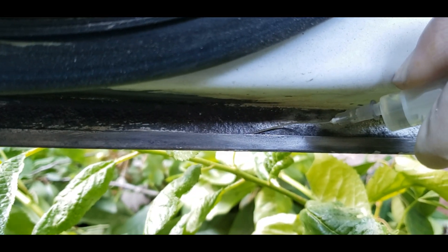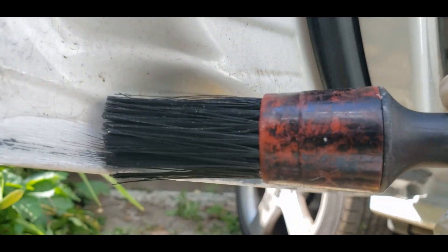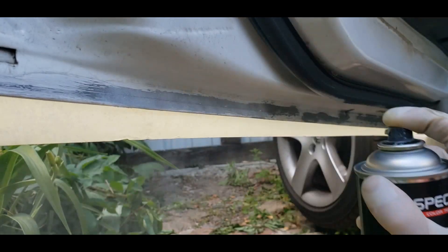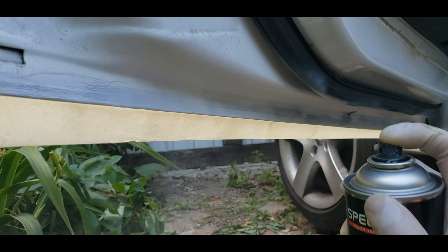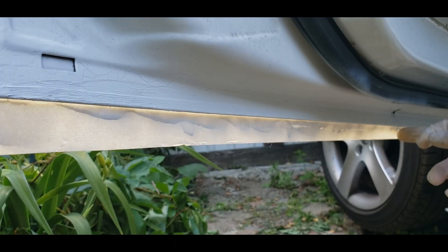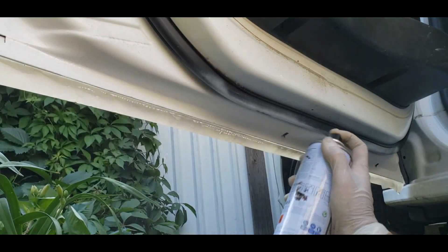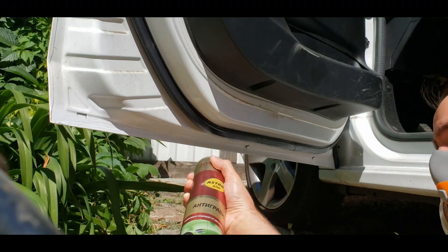This time I had to pay more attention to rust sanding and I had to increase the rust converter exposure time. However, after sanding the edges and taking a closer look, I realized that the rust doesn't come out of the door's edge pocket. It reappears only on the outer surface because the door's edge pocket is not deformed and it's too tight so that even a needle couldn't pass through.